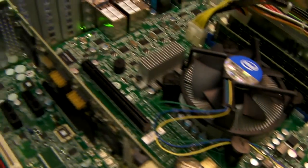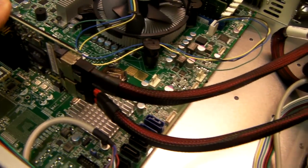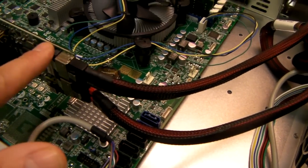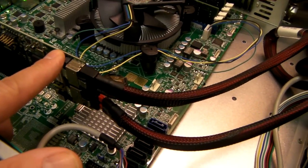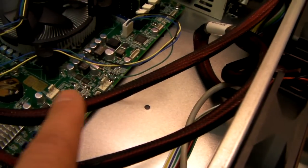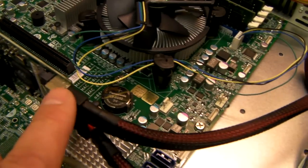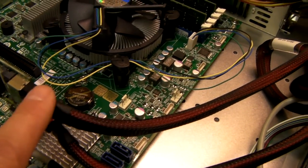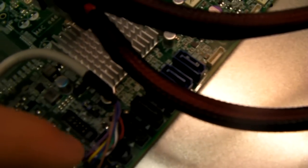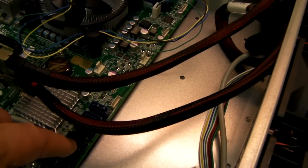In this particular build, the customer has an 8-port RAID card, so simply 2 cables control the 8 drives. This is what's known as an 8087 to 8087 cable, where the RAID card has the same connection as the backplane. However, if you wanted to go directly to your motherboard connections, you'd need what's known as a reverse breakout cable, which are on our website.